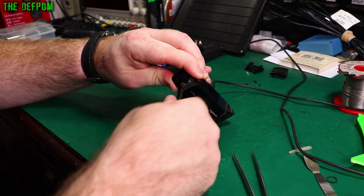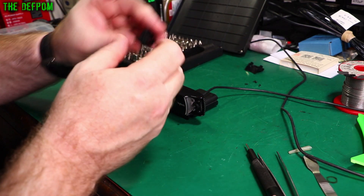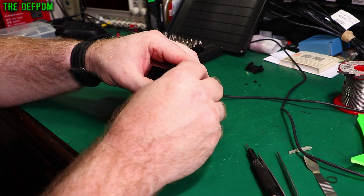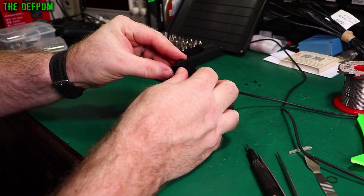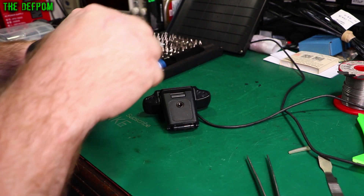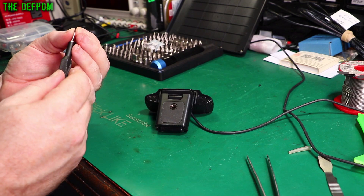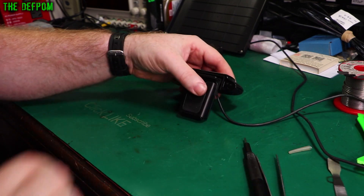So if this fixes your problem and you do this to your camera, don't forget to share the video to your friends or social media, and give me a like as well — it helps my channel. I'll test it before I put the little sticky bits back on again, just in case there's a problem, so it's not too much effort to disassemble it. It seems this is a fairly common problem with these cameras where the focusing hasn't been set correctly from the factory. I'll be honest — I put it back together, tried it, and it was much worse. Pulled it apart again and now I've tweaked it in position.